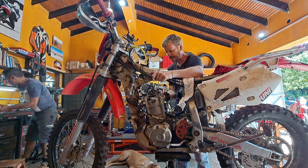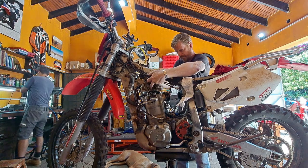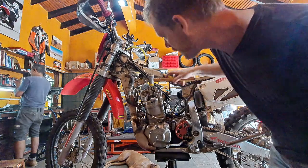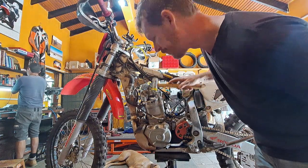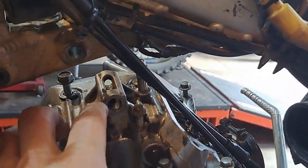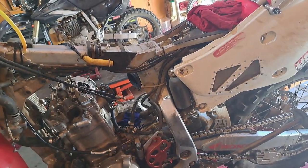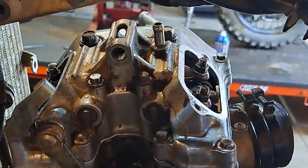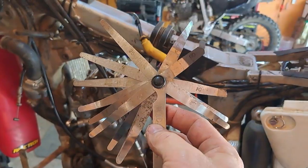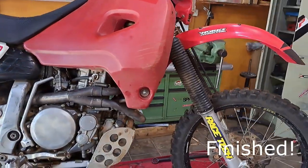There are no O-rings on this part of the assembly but there are two pins - one here and one here. We're back on. I've replaced all 14 bolts - it was very easy to figure out where they go. Eight millimeter bolts are 23 Newton meters and the little ones are 12 Newton meters. It's tightened down. The next job is to check the valves. Adjustment made - 15 and 20 - double check that in the manual.